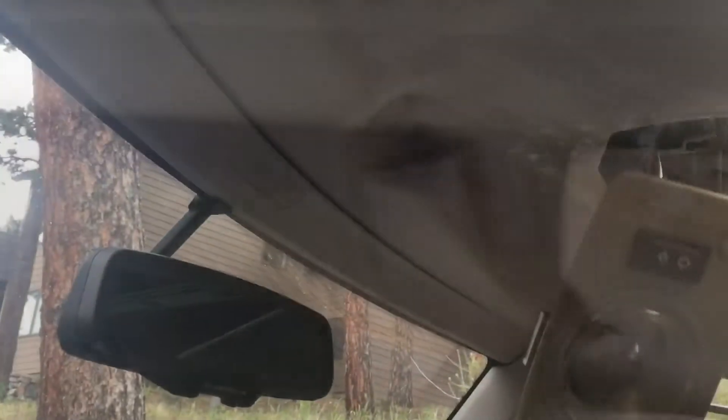Don't forget to replace the stopper and all your hardware, then bring it on up. That'll be six nuts going on six studs. Then, before you get too tight, test the glass opening and closing — remembering that the glass is supposed to bring the headliner sunroof card with it when it closes.